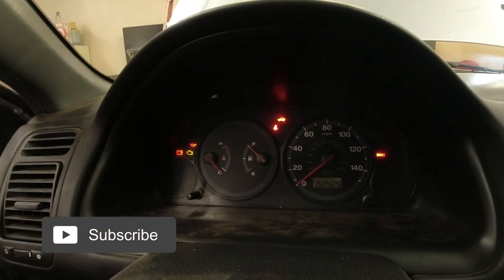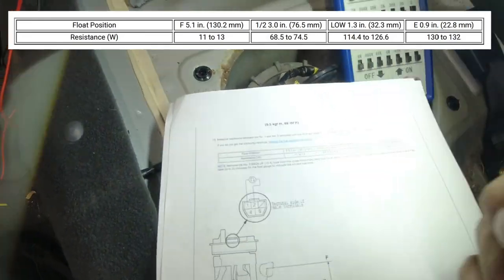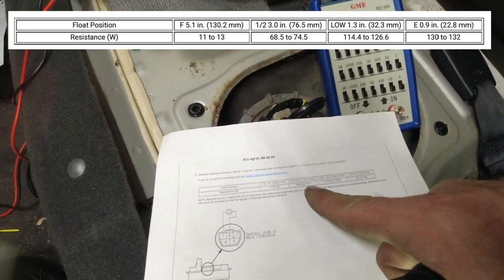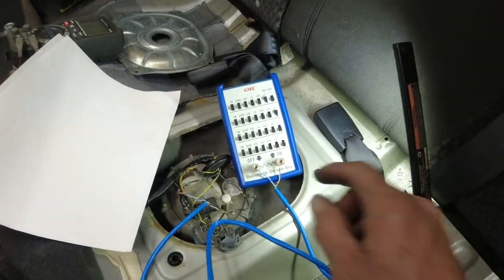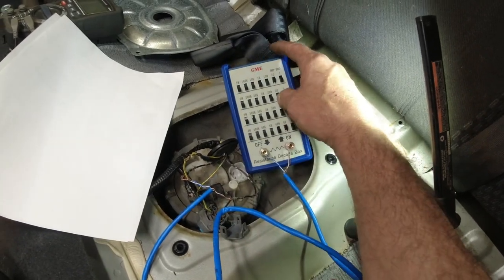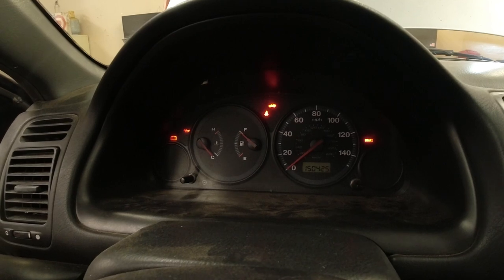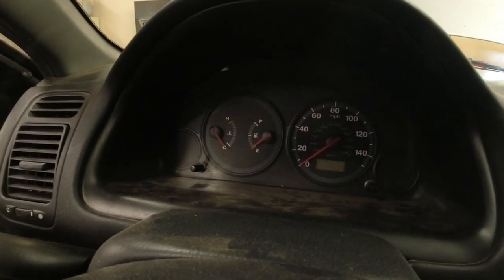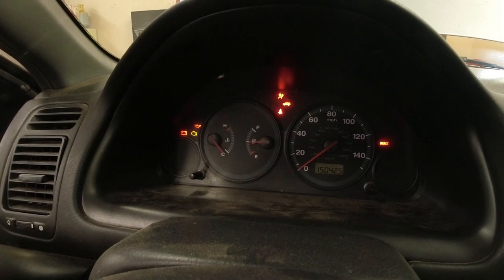Now something like this - we know a full tank is 11 to 13 ohms. If we want a half tank, we go to about 68.5 to 74, about 70 ohms. Right now we're at 12, so we need another 60 ohms - we can go 40 and 20 to make 60. Give it a 40 and 20, should have a half tank of gas now. Cycle the key off - there we go. Sweet, we know it works.